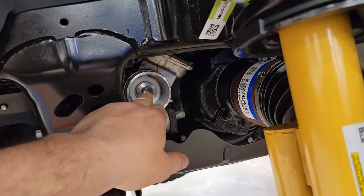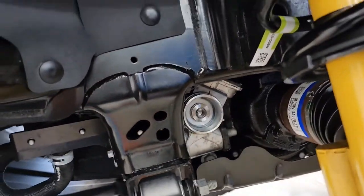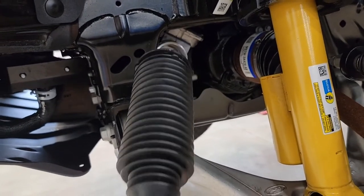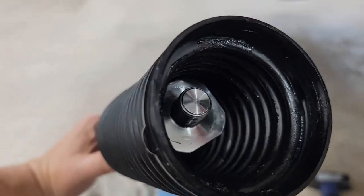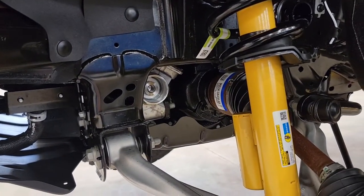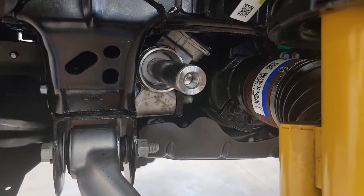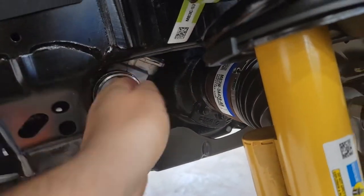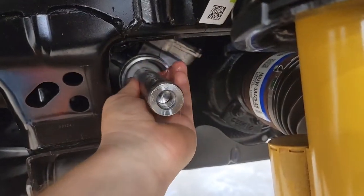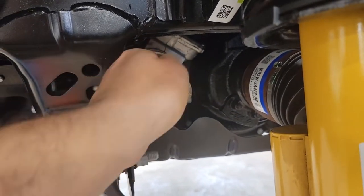Next we just need to reverse what we did to take it apart. We're going to turn the steering rack all the way to the driver's side to bring that out. We're going to put our tie rod back on — that screws into there. We'll use a little bit of grease on that steering rack, and on this end there's grease in there from the factory. Turn your steering rack all the way driver. There's grease on the steering rack from the factory, so I'm just going to grease this up now — put a little grease on those steering teeth.